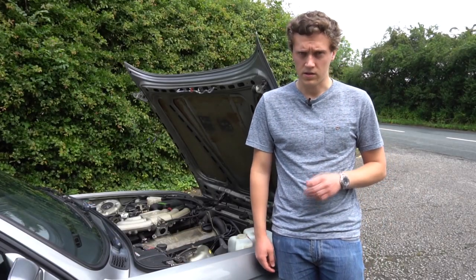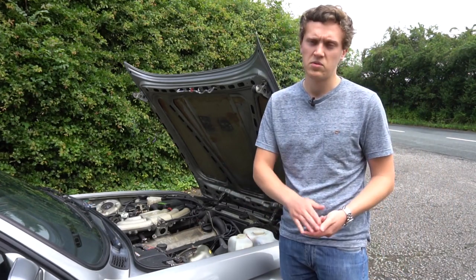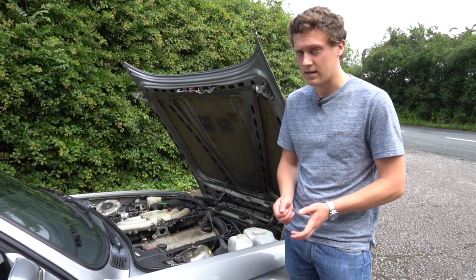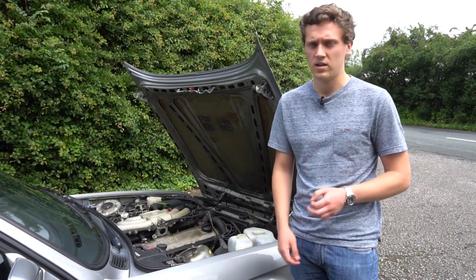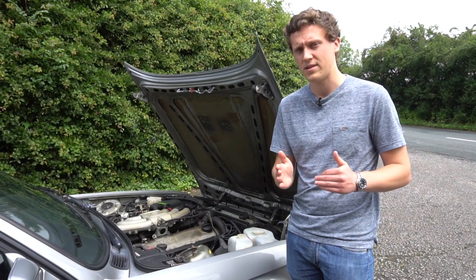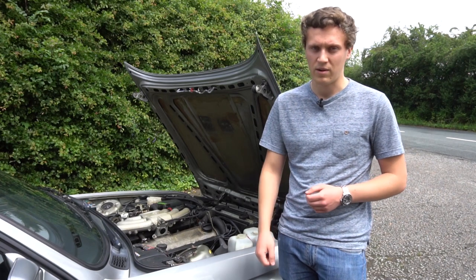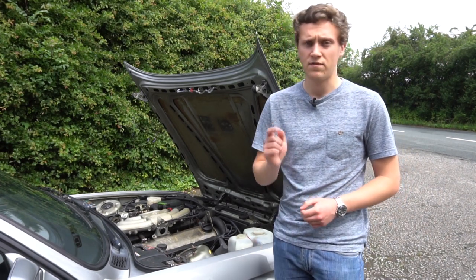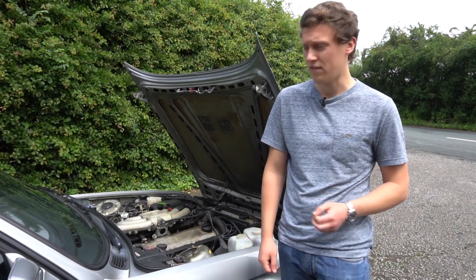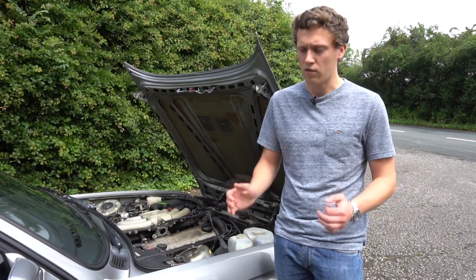There was a wide variety of engines that came on the E30s. Most people are going to go for the M20 engines — the 320i, 325i, and for the US the 325e — these are inline six-cylinder engines. The important thing is that it's an interference engine, which means the valves and the pistons actually have a crossover in their paths. Therefore timing belt changes done frequently and as per BMW's recommended schedule are very important, because if that timing belt snaps, the valves are going to collide with the pistons causing catastrophic engine damage.